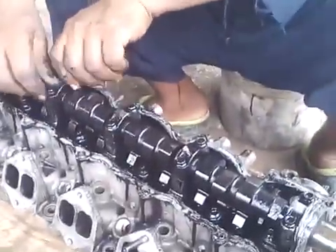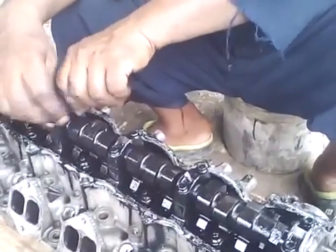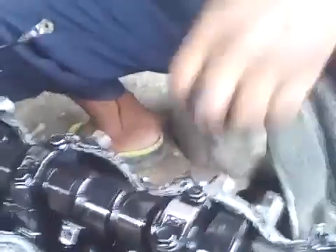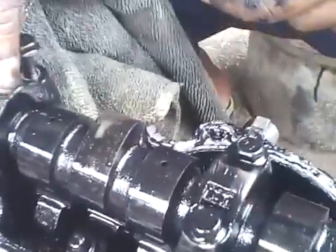I'm not ready to stop. That is the camshaft covers - the camshaft bearing cover - being removed. So you have to notice they are marked. Yeah, they are marked: one, two, three, four, so on. Bring it right up. Yeah, you're seeing it. Wiping out the oil. So you see it starts from one - dash five. Right, and then it goes to one, two, three, and then finally four.